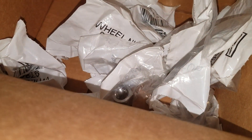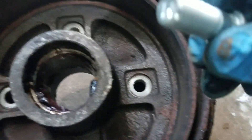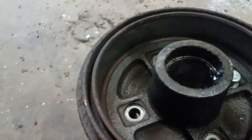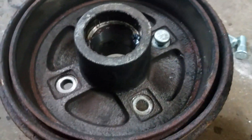I bought a lot and I'm only doing one side because I'm lazy. Apparently 15% battery's too low to use the flash, so let's do this here in the dark. So a socket and a socket — get them the exact width apart so that those holes go directly into the sockets. Then you take your lug stud and put it in the hole. There's little grooves in there, then you take a hammer and just set them. It's easier to do if you have two hands, but you get the idea — it's not rocket science. Then you do four more and then you're done.